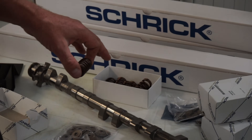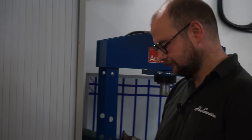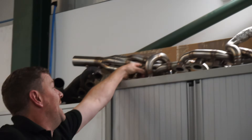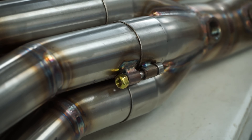Have you run many of these cams in the V10s? I'm quite curious to see how they do. We've done a few S65s, which as we were saying are a pretty similar engine — people think they're exactly the same but they're not, though they are similar in terms of valve train. I've done some S65s that worked really, really well — strong numbers and a nice nature of power delivery. It'll be really good to see what this combo does together with the ported heads. We've also got some headers that we manufacture, so the whole combination together should work quite nicely.